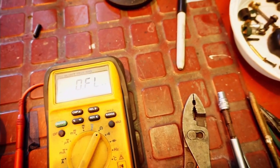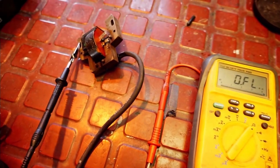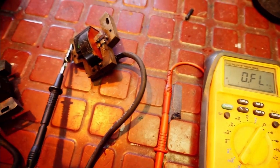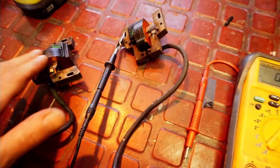1.13 on the other one. You can also test it from the plug wire to that connector - you should have very little resistance, because what you're doing is you're shorting out the coil, but there's electronics in here, so you wouldn't want it to be more than a couple of ohms. One ohm is almost a direct short and that's what you want - more than that, like in thousands or hundreds, then the coil's not good. It may not even shut the engine off.